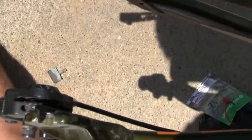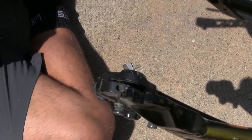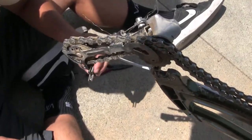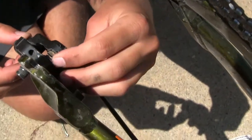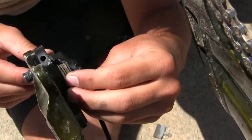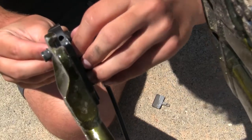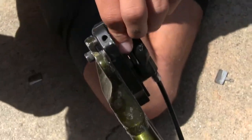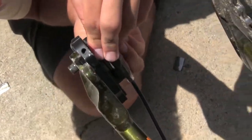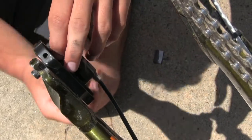So there's a little circle in here that we had to just push back. This is the piston. Basically, if your new pads are too big, you're going to have to push that back to fit the new ones in. Jamie, go for it. This is hard to get a good angle. I believe in you. I think we're going to have to keep pushing there. That looks like it's it.